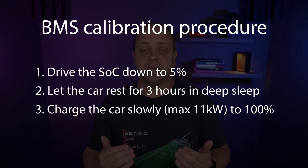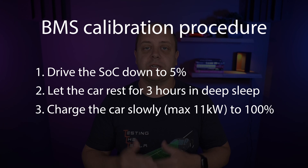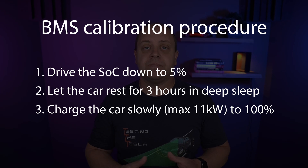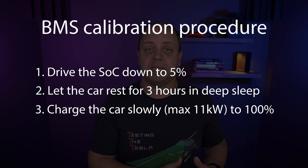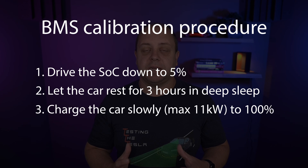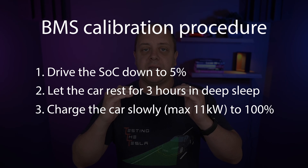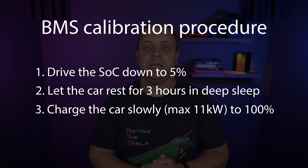At that point the battery can determine the zero point of the pack. Then — the second step was leaving it for a couple of hours — the third step is to slowly charge it all the way up to 100%. Above 90% is okay, but it is recommended to do 100%. Why? Because of that balancing that is going to happen also at the very top end. The balancing is happening all the time, the cells are like communicating vessels, and it's at that 100% that you do the final perfection step on the cell balancing.